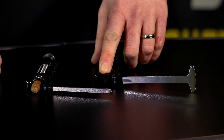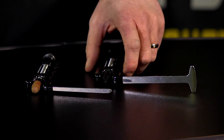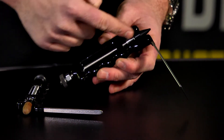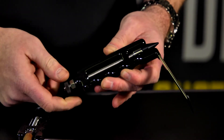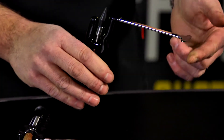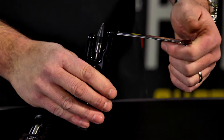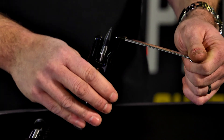The tool actually comes with this Delrin tip here — quite a unique tool. It has this adjustable arm, so the tip can be pivoted up using this screw thread to different heights to clear braces. What we can actually do now is hook this tool into a brace and, using an upward motion, this tip can be pushing the dent out.